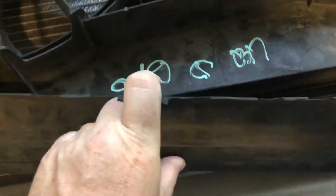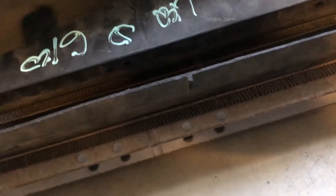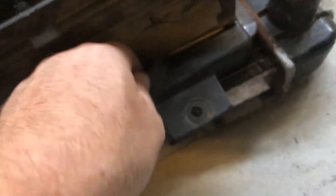The bottom edge of this piece is rubberized and the rest is hard plastic. We can slide it in the bottom and tuck it in — that fills up nicely all the way across and covers the gap. We'll trim a little off the top and shoot some screws into the bottom to keep the airflow trapped where we want it without a big leak at the bottom.